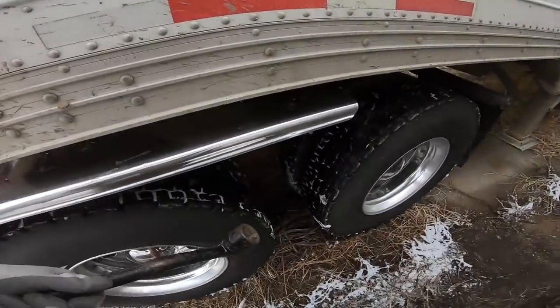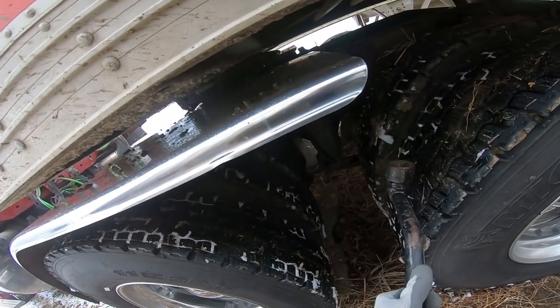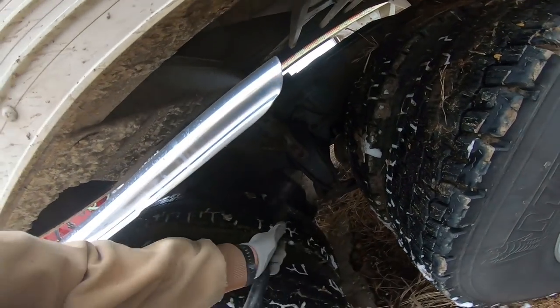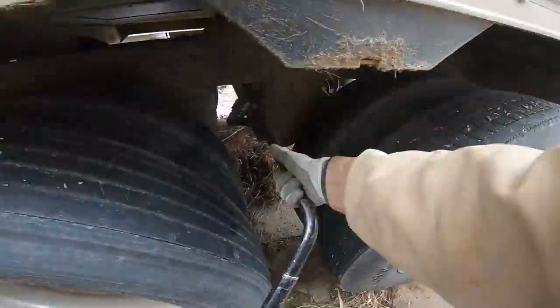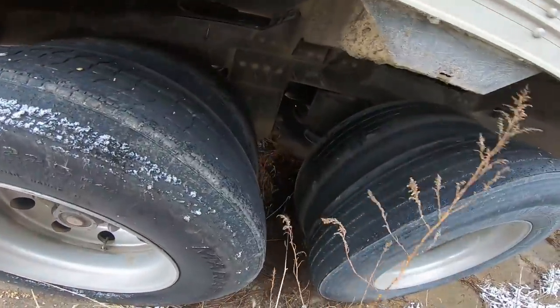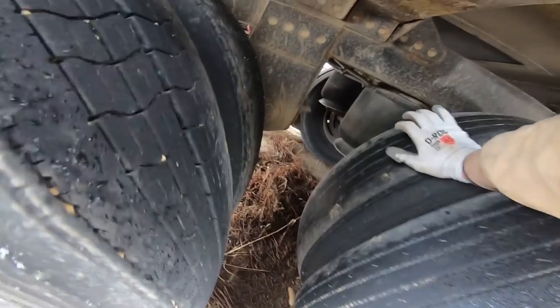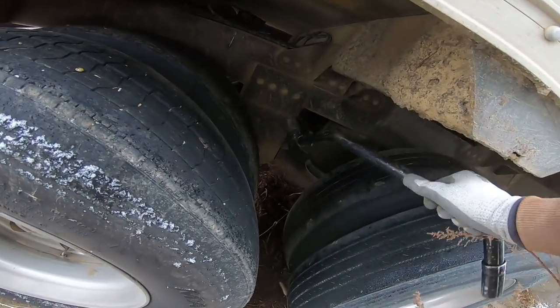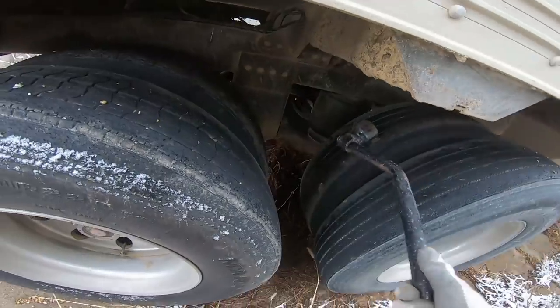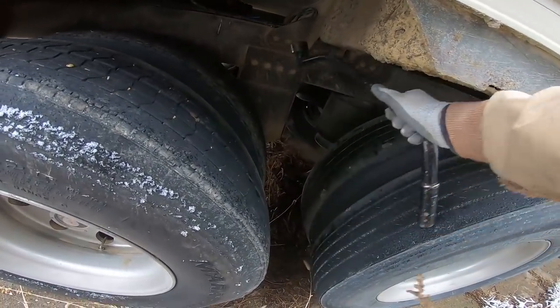Put my marker lights on and make sure all my lights are working. Then go through and check all the tires — this takes some getting used to, to feel when you have a low tire. It's much easier than taking a gauge and spending an hour checking tires. That tire right there is low — I shouldn't be able to push on it like that. You can tell by the bounce; these have a thud but that one doesn't.